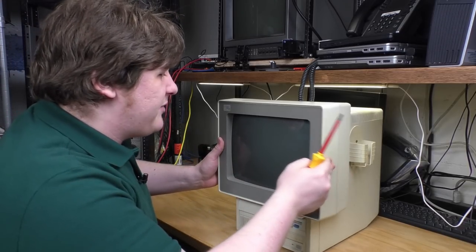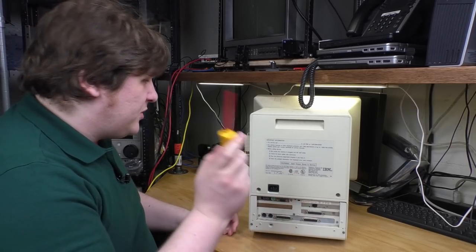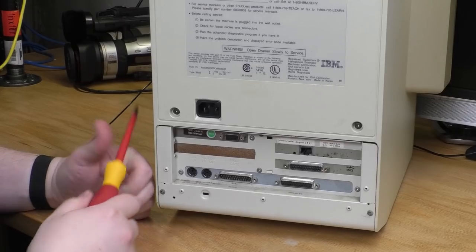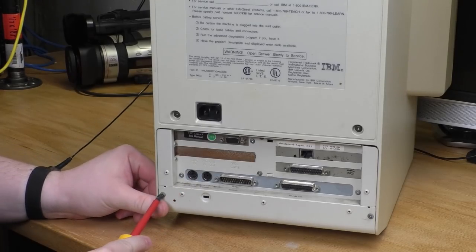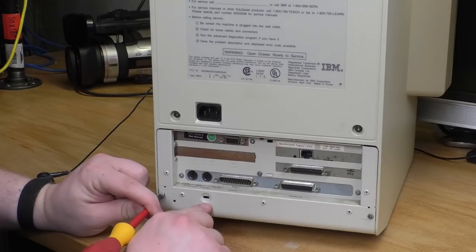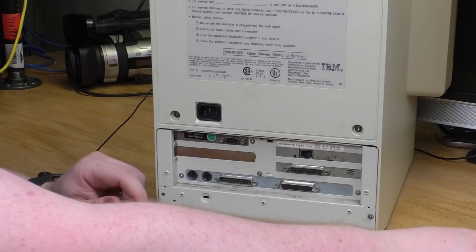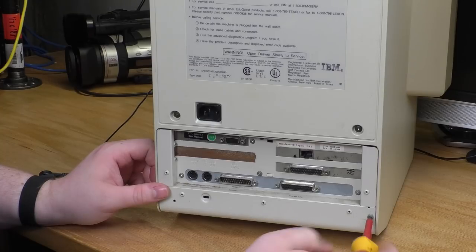Number two Phillips screwdriver. Simplest thing to do here, just pull the motherboard, for which I need a static strap if I'm going to be responsible. Now, I'm not sure which screws need to come out. I'm guessing it's these two here and on the other side. By the way, this seems to have a Kensington lock, which I guess those were around in '93, but it is weird to see on a desktop PC. I think probably the other school-intended computers probably had that as well.